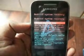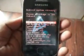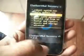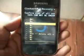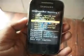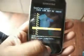I am on ClockworkMod recovery. Select 'Apply update from SD card' and click on ClockworkMod. Select the Matte Team Galaxy Wire zip and wipe data — yes, delete all. Wipe cache partition and yes, wipe cache.